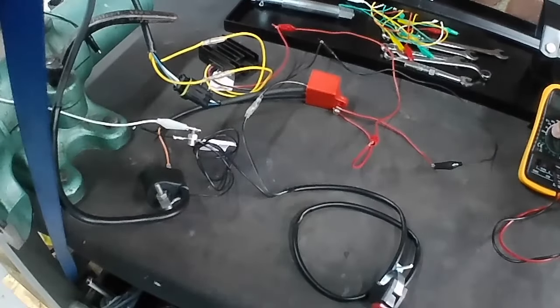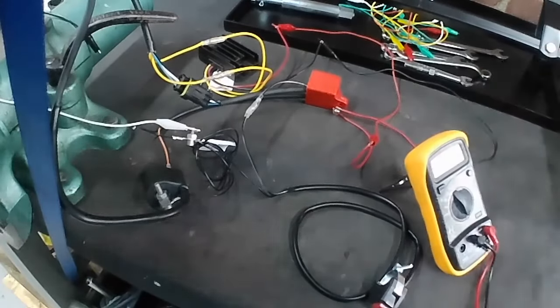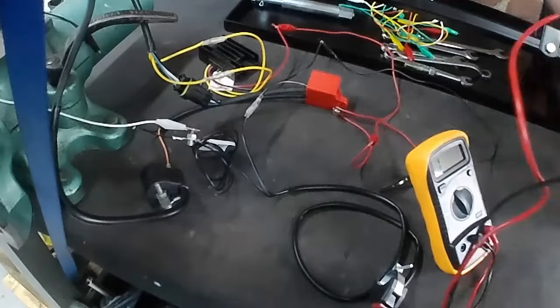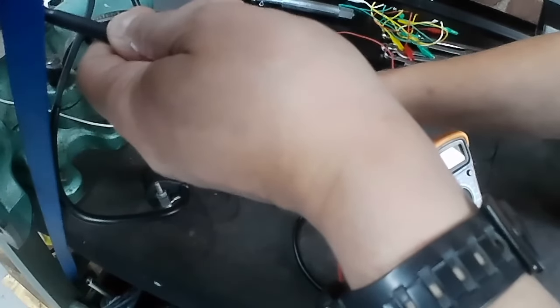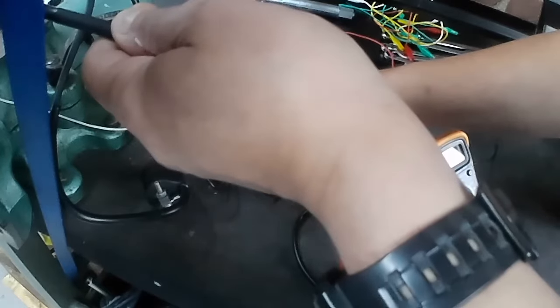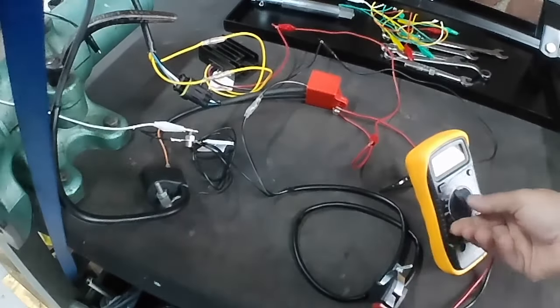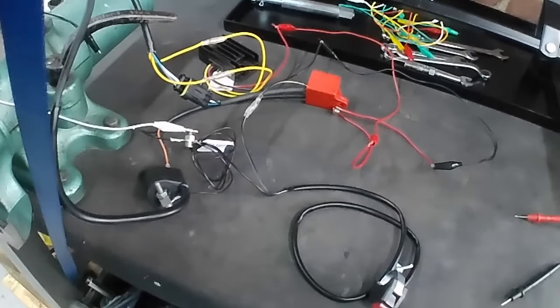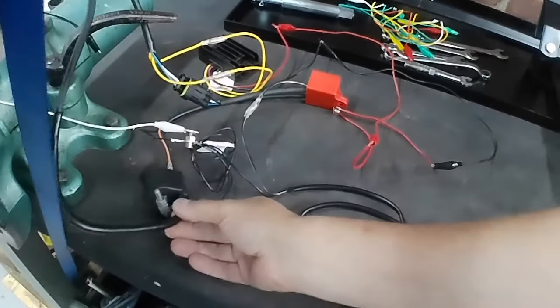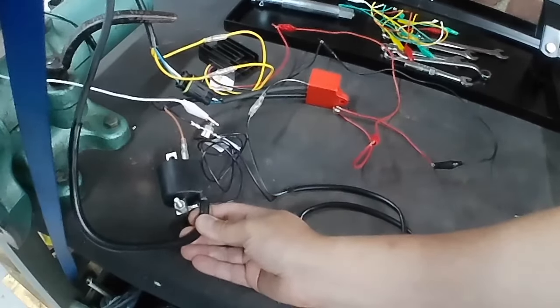Let me just show you with my diode setting. If I put one probe on the engine, one probe on that mass earth, we get tone, which tells us that everything's bonded and earthed to the engine. So that's good. We've got our ignition coil connected into our CDI,